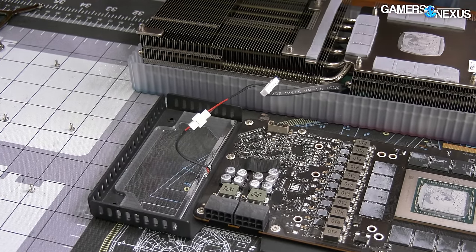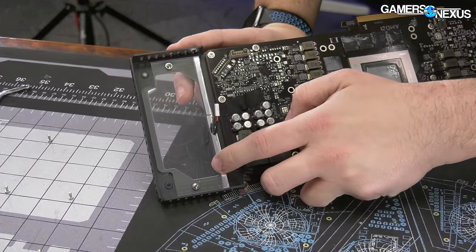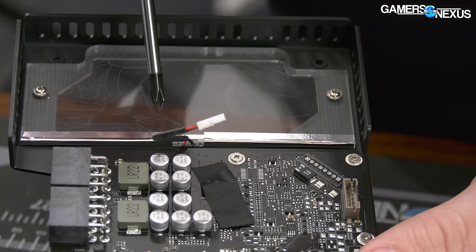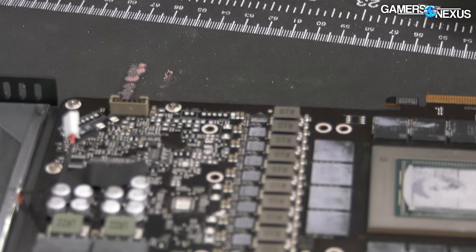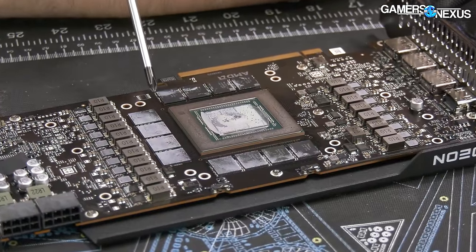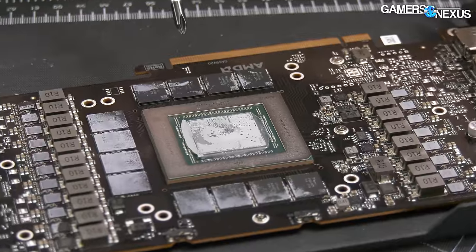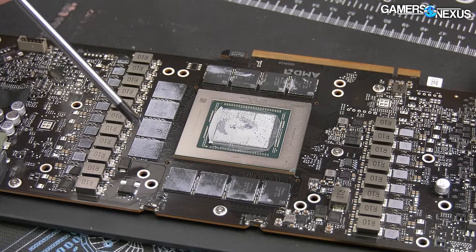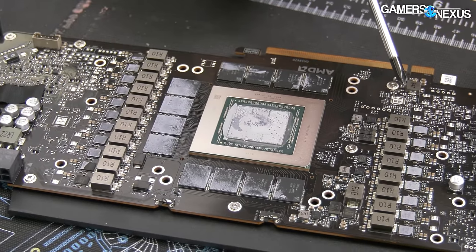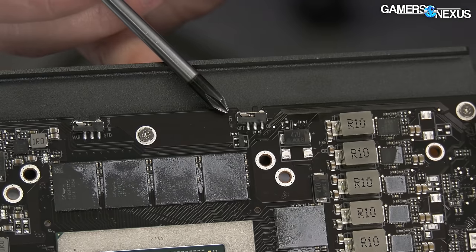All the fans connect via a single connector for fan RPM and LEDs. This is actually a really nice LED implementation - they've got a foil tape in there for reflective purposes, with two wires going into a tiny PCB casting light sideways into the plate. Simple but very effective. For memory modules, they've gone with four on the bottom - that area normally runs a little warmer because it's right against the PCIe slot. Then there are four more between the GPU and the VRM inductors, with more VRM over here, and the rest of the memory up top. There are also two very small switches - one labeled LED_SW for the lighting toggle and another for BIOS selection.